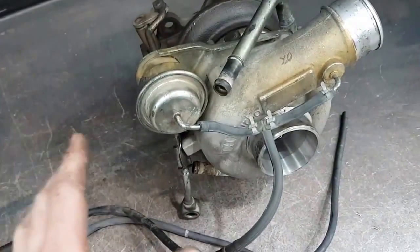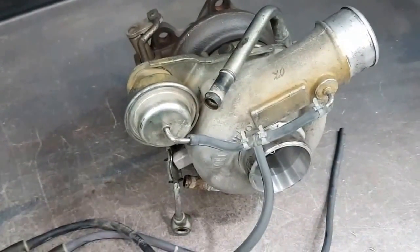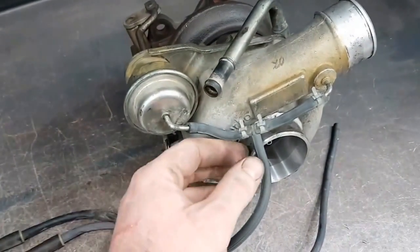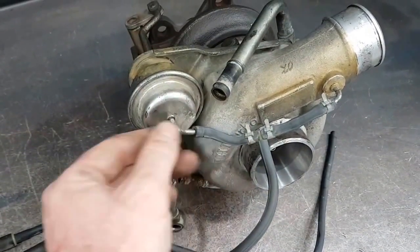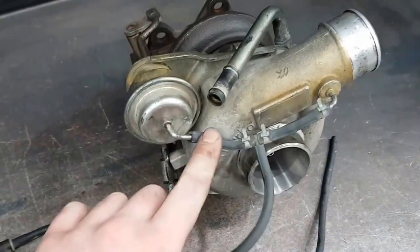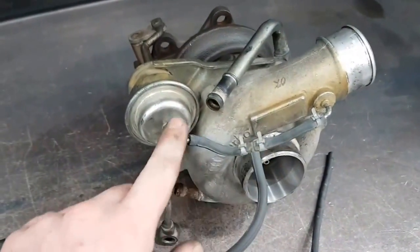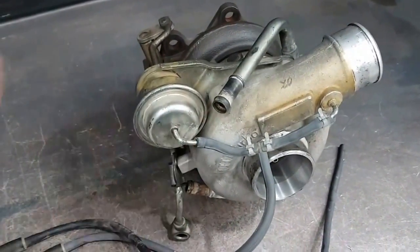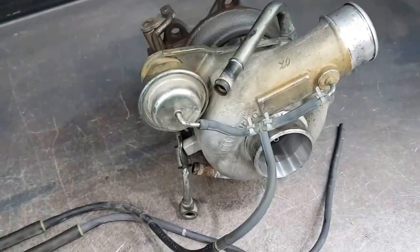This is great for factory setups — control is good enough. If you want to run higher than factory boost pressure, the issues arise in that you'll always have an inherent amount of air hitting this actuator arm just because of the design. The air can always come through; no matter how much you bleed away there will always be some. For most setups that's fine, but when you want the best control we swap it out to a 3-port.